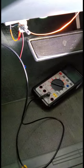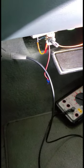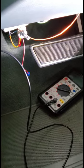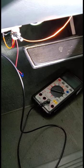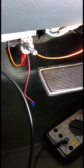Here's something else I should have mentioned in my previous video. I also wanted to confirm that the low reading was correct. I disconnected the rheostat from my gauge, hooked up my meter, and knowing that when the fuel level sending unit is on empty it reads 74 ohms — plus the 1.5 ohm resistance of the wire — I set my rheostat to 75.5 ohms.